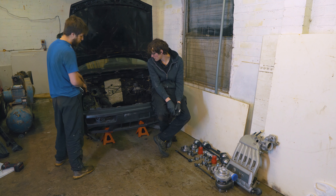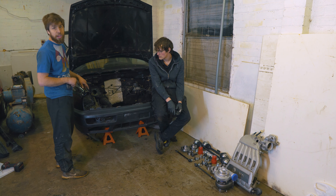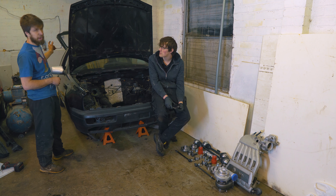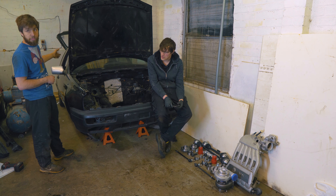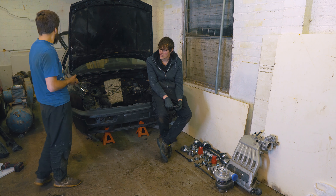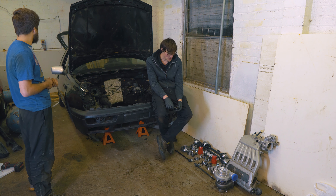The car itself is a Mk3 VR6 from the factory, but someone has used it as a track car previously. As you can see in the video, it's been all gutted — all the panels — it's got plexi windows at the rear sides and the front, both front sides are plexi, the boot is plexi. It's all been skinned and gutted; basically the boot's got no rigidity whatsoever and it doesn't seal either, because too much of the metalwork has been removed. So we need a new boot.